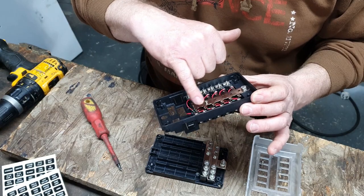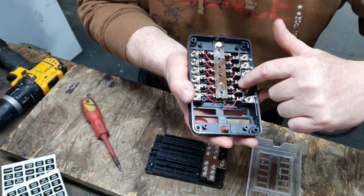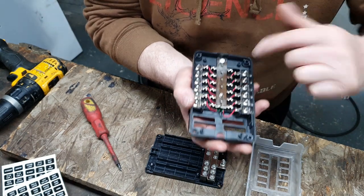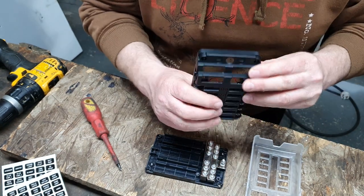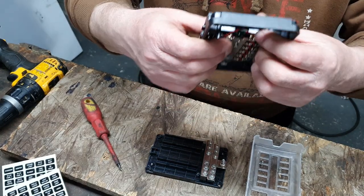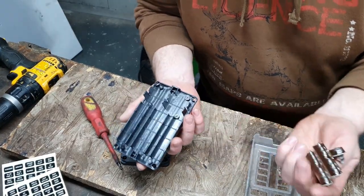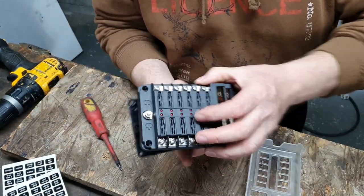On the other side, these are all connected, but as you can see there's a gap between these - so these are bridged out when you put the fuse in. When the fuse goes in, it makes this part live. If we put a fuse in here, this becomes live. If there are no other fuses in, none of these are live because there's no connection between the positive feed and the battery. You can also see there's a little circuit board under here, and on that circuit board is what controls the LED lights.